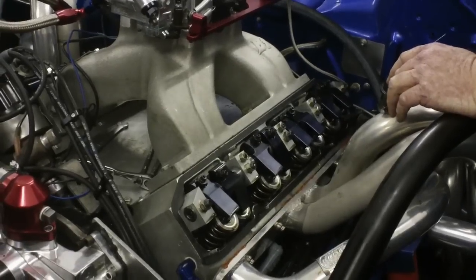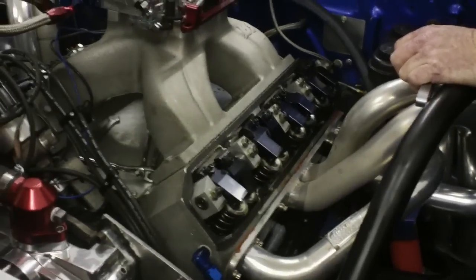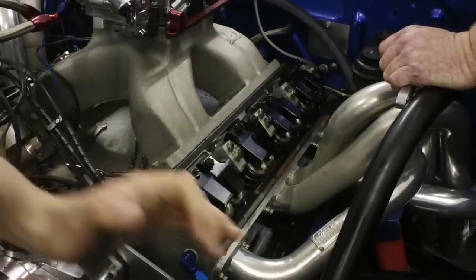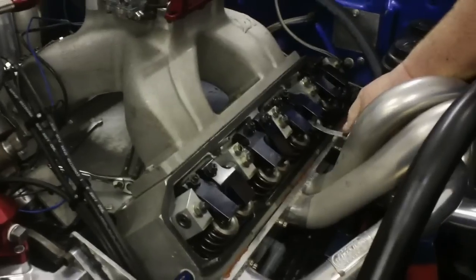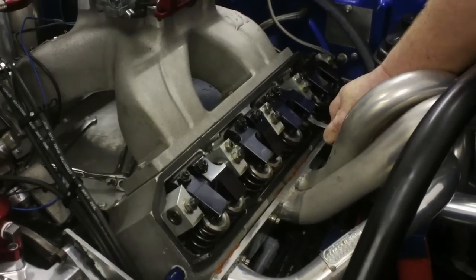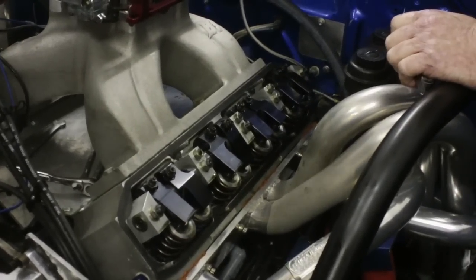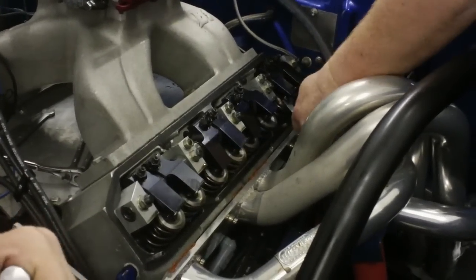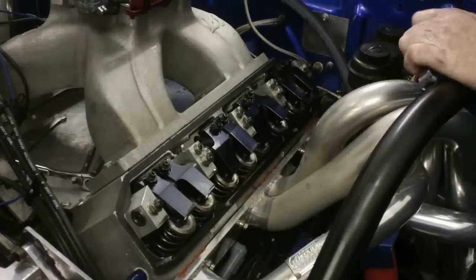Back exhaust. Okay, now we're going to start watching our exhaust so we can start adjusting our intakes. Oh, this exhaust just started to move, so I'm going to adjust this intake. Oh, there we go. And that one's good. Third intake. Yep. Oh, right there. That one's good.